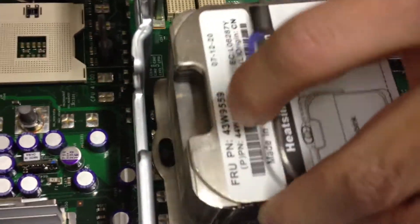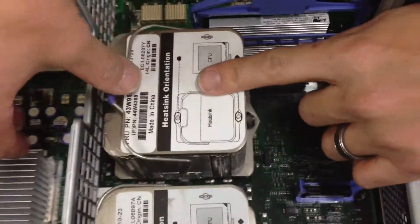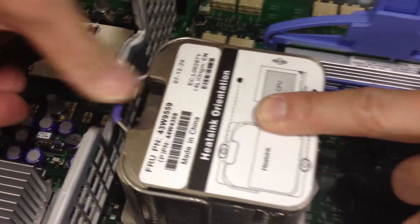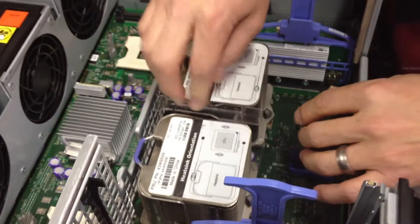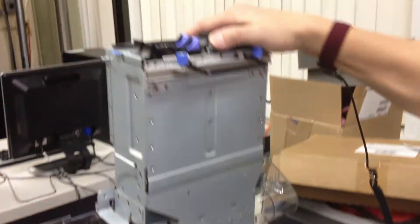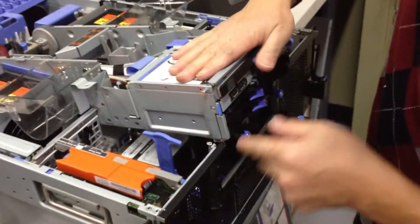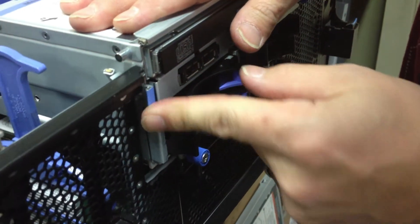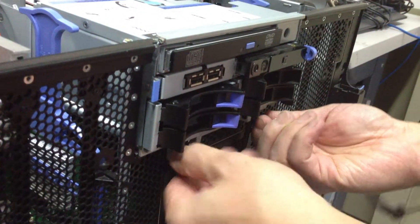All this stuff should be pretty gentle. The purple handle needs to be up — the purple handle was down, that's why it didn't go in. So with the purple handle up and it's in the post, press down. I usually have my finger on the other side of the heat sink as I press this part down. Don't forget the air baffle — it just kind of settles in there. Takes Herculean strength to put the media tray back down. As it goes down, remember to put the tab back in. Press it firmly in place, and remember to screw the media tray screws back in.